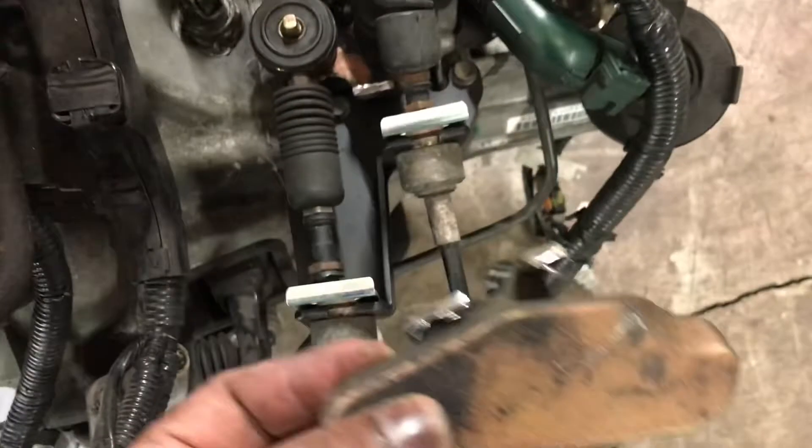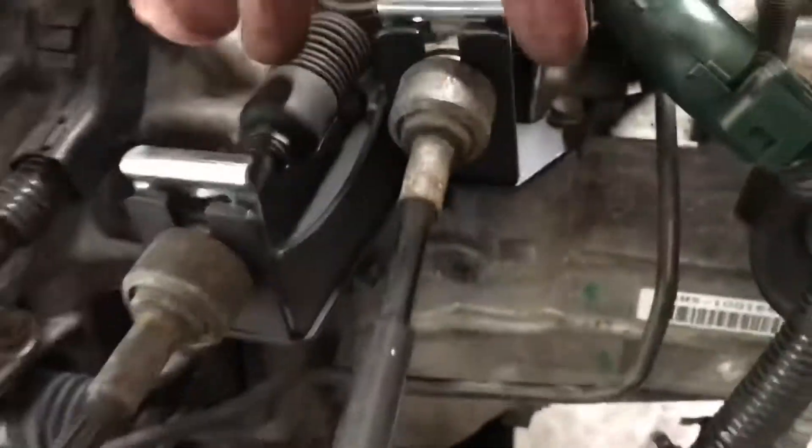We chopped off this piece right here and I put this little piece from Hux Performance. We put a washer right here — they gave us a smaller washer, you put right there. It's really simple, just a number 12 right here and two right there, and you kind of just put it on the shift linkage.